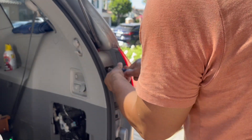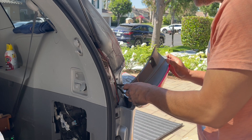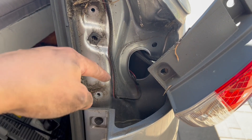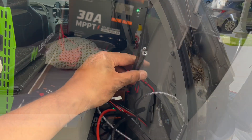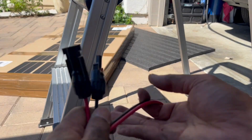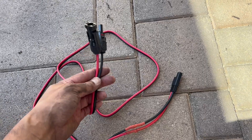I'm going to remove this — it's actually pretty easy. Here's my old wire. I did a little drip line so I made a drop, and then it comes back up. So if water comes down, it just drips — it won't travel uphill. I'm going to remove that and do a new wiring. Into my car charger I use this SAE port, so I need to convert it. I got this line connector and I'm going to cut it and splice it onto this. I made the connection, so now my ports are good. Let's start hooking it up.